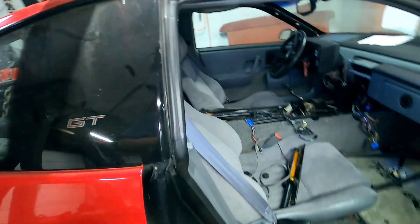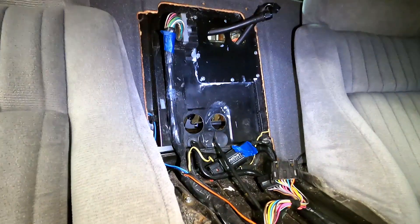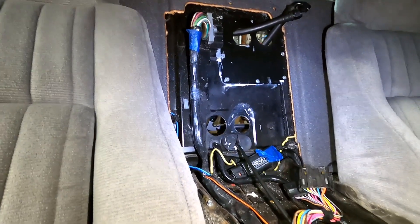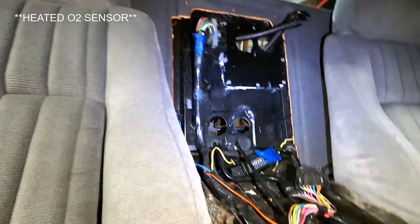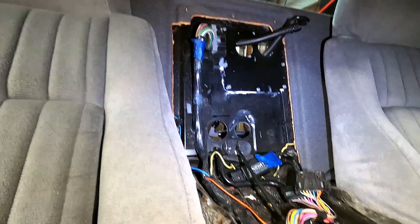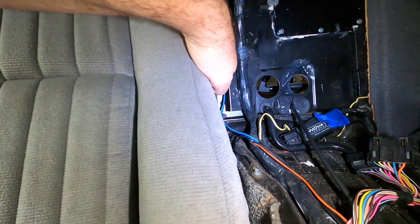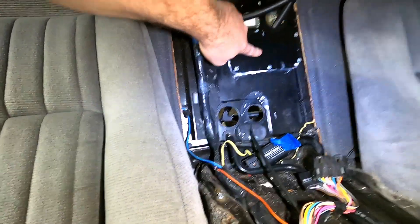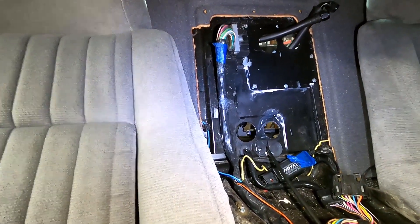Garth is going to be here Saturday and we've got to get started on the wiring. I have the Hybrid Racing case universal K-series breakout harness — essentially it gives you a relay for the starter, fuel pump, and one other; three relays total. You connect three wires and your Fiero will run with the K-series. It's what we used on the blur. I've got to fit up the ECU but I'm going to remove this extra bit of metal with the Dremel, give myself a flat surface to mount the ECU, and make up an ECU mount.